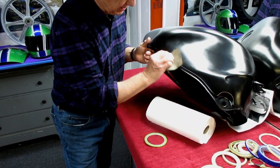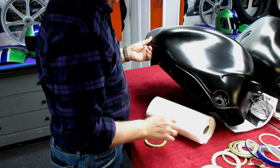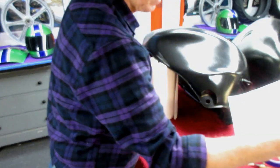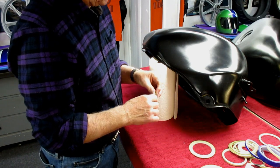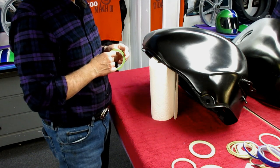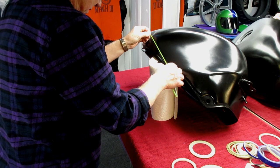I've got one little spot in the paint that I'm not happy with, so I get rid of that right away with a little 2000-grit paper — I don't want the tape going over that. There's a little touch-up to deal with but nothing we can't live with. I want to make sure I get this stripe exactly the way he wants it. If I were to use quarter-inch tape it's going to bend around this severe corner, but if I do two stripes of eighth-inch tape I'll minimize that possibility.